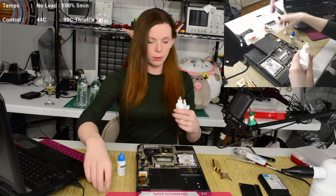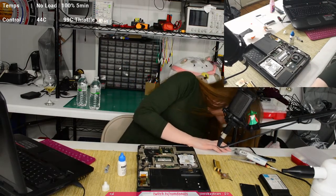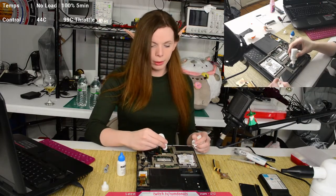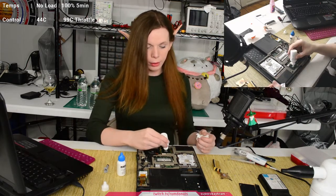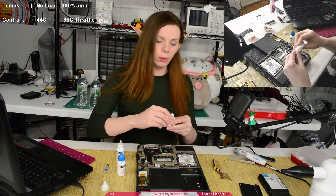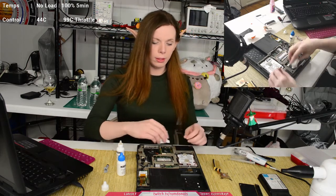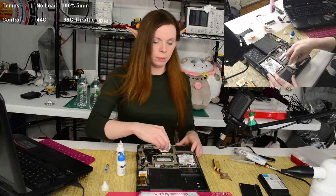Alright, so let's remove some thermal material. Or just drop it. Make sure my ears are good. This stuff will evaporate pretty quickly because I'm pretty sure it's alcohol based. You know what? That thermal material wasn't on there all the way. It spread out, but on the edges, which I bet is where that really hot core was, it doesn't have any really. Oh, I love thermal remover. Is there a hair in there? It's gross. Someone with a beard in this thing? Yeah.